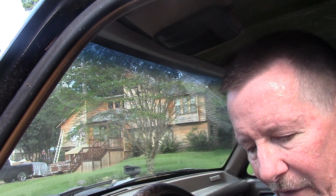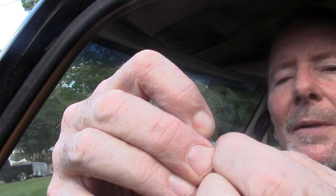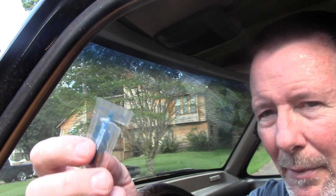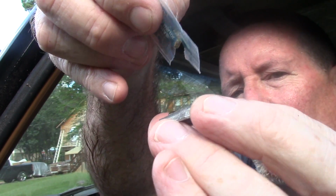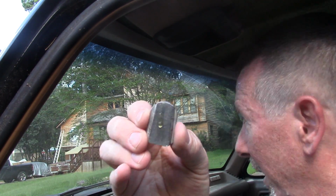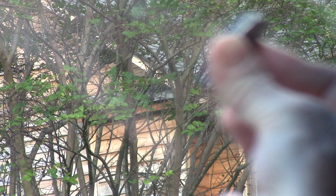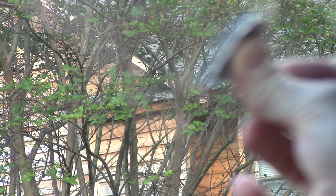Not touched either surface. I'm going to take the adhesive package, and it's got a little split on the side of it. I'm going to rip it across the opening, and then squeeze out one drop on the back of the button. Let's get 1 drop. There we go, 1 drop. And then we're going to put it up there with the round side pointing up, and we're going to just smear it around a little bit so the adhesive is there, and just hold it in place. 1001.